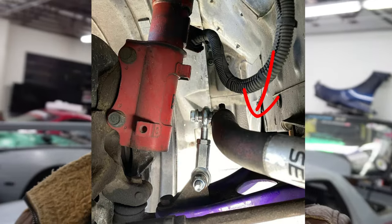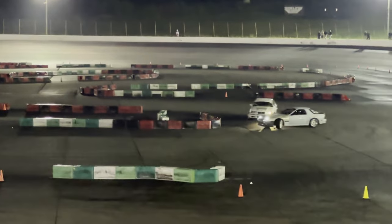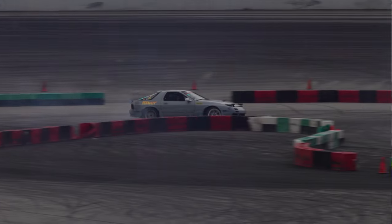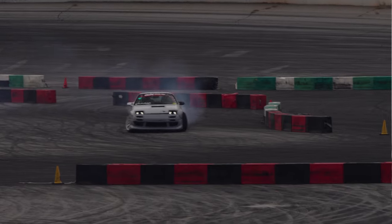I'll include the link to their website down in the description below. Another thing to expect when you install this kit is that your wheel will be hitting the front sway bar underneath. If you're using 16-inch wheels on the front it should not really rub the sway bars. Once I went up to 17s, my tires were rubbing the front sway bar and it was causing me to spin out. So last year I removed the front sway bars and kept them in the rear — it was a good setup and I wasn't spinning out as much.